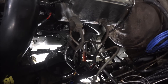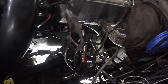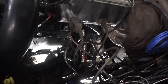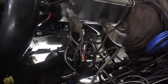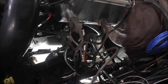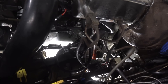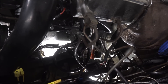Hopefully that cures the oil leak. I couldn't get it to seal up with two gaskets — I don't know if it's because the gaskets weren't exactly the right stamp, or if it's just the poor machining and unflat surfaces of the spacer plate and that fuel pump. But hopefully the Permatex RTV will seal it up and do the job, and this thing will be ready to go. We'll find out tomorrow.